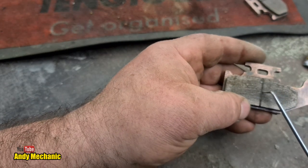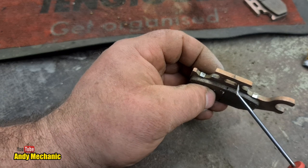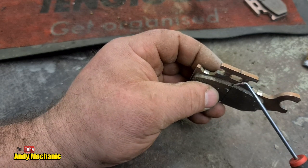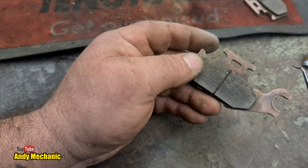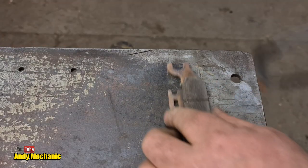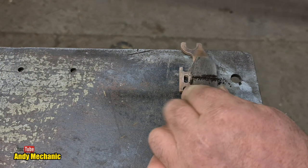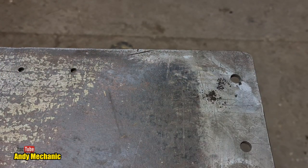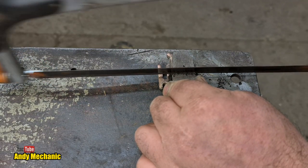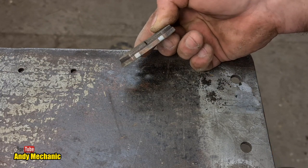This groove down the middle isn't just to help dissipate water and dirt and get it off the pad surface - it's actually a wear indicator. According to Suzuki and quite a few other motorcycle manufacturers, if you can still see the groove your pad's still good to use. It's when the material's worn down enough for that groove to disappear that's when you need to replace the pads. Pretty simple. A hacksaw blade is the easiest way to clean it out - just back-blade it, it pulls all the dirt out. You only want to use the back side of the teeth so you don't dig into the pad. Excellent - heaps of wear left on those pads.